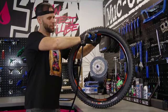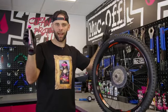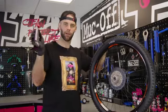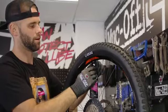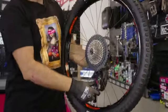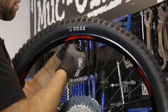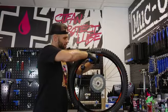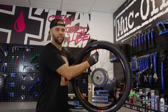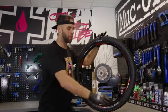So that's the tyre popped onto the bead. Next step is obviously putting the sealant in. Have a look at the instructions on the back to tell you how much you need for your particular tyre. These are downhill tyres, so these require the whole pouch. On a mountain bike, we want between 25 and 35 psi. Obviously, if you're a dirt jumper you might want to go a bit higher. If you're riding in wet conditions, you might want to go lower.